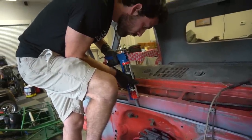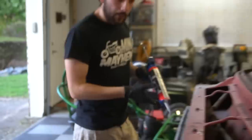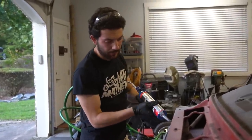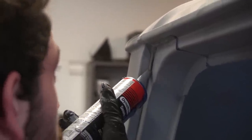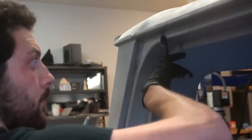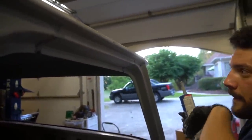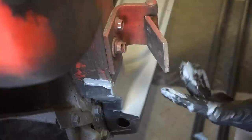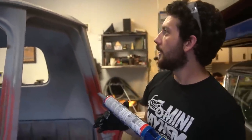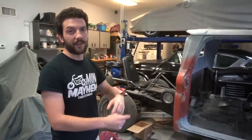Here's where it gets fun. So I have the firewall filled in decently well. I'm going to move on to the seams up on the cab. Okay, that's all the seams I need to seal for now. That's all I have time for tonight, guys. I did some painting and did some seam sealing. I can let it dry, come back another day, start sanding.